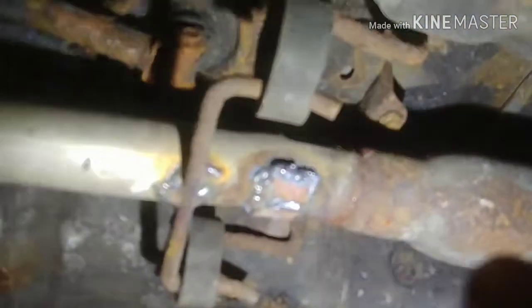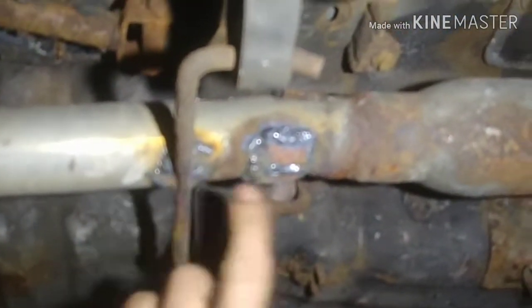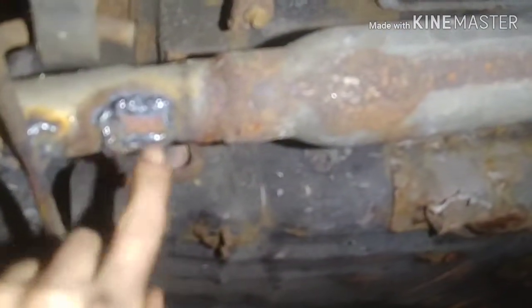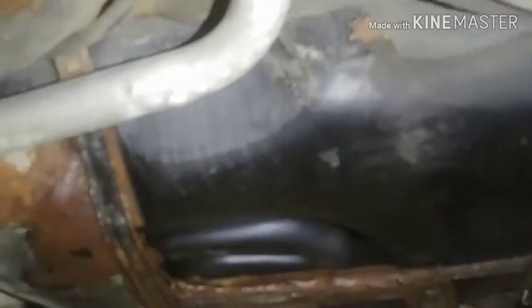Had a hole in the exhaust. The hanger flexed and broke it. I took the hanger, flipped it around backwards, so now it'll break a new hole over here, but I welded it all up, put a piece of 1/8 inch steel plate on it, cut a V in it, bent it into a V, welded up the V, welded all the way around it, quieted up, deleted a heat shield, deleted some of the fuel tank skid plate. Mostly it just pulled down.